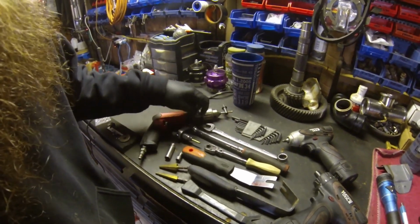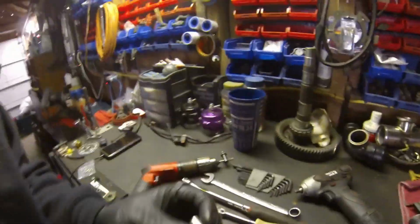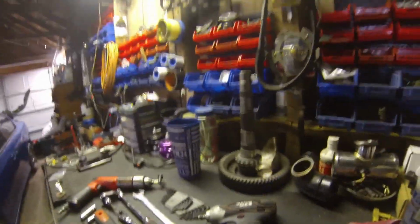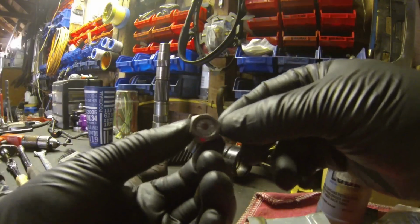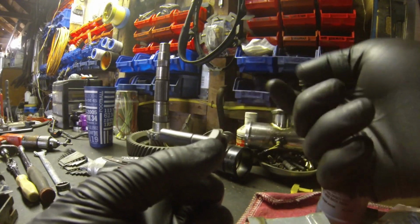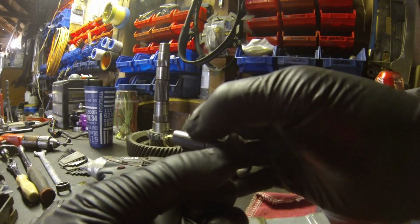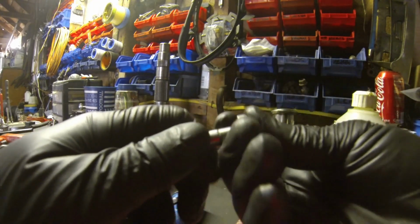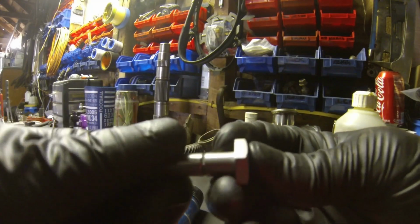You use a 17mm wrench on this end, and then when you tighten that bolt, what it's going to do is, I'll set this down real quick, make a little bit more sense of this. When you tighten the Allen screw here and you hold this sleeve with a wrench, it's going to suck this piece in and it's going to operate like a rivet. It's going to spread these ears open against this taper that is in that nut. So that is what's going to bite.